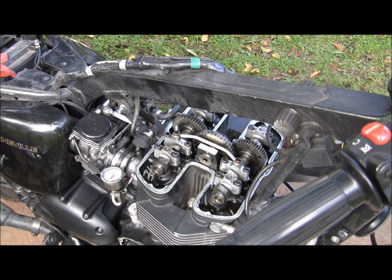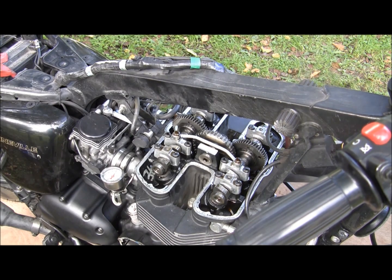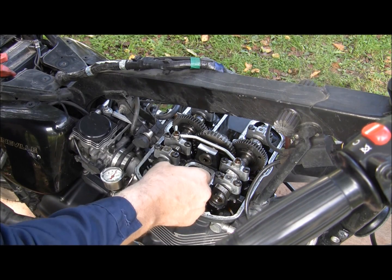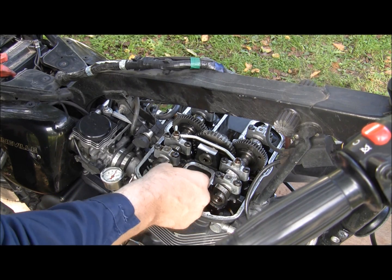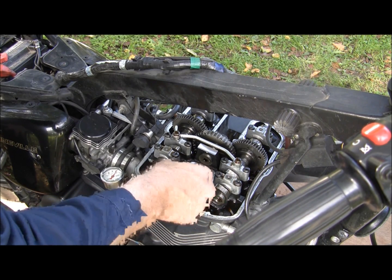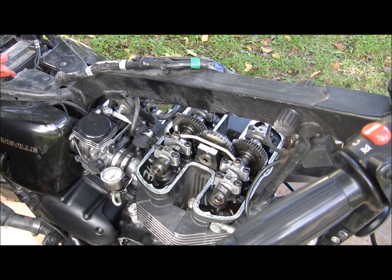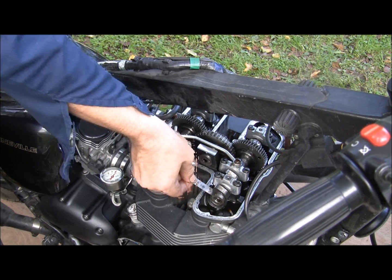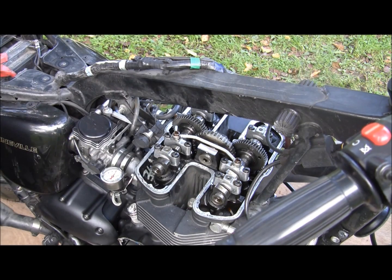Now, some time has passed, so I'm going to run the checks again real quick. The I1 last time was at 15. It loosened on me. So it's loosened in three months. Not much. So 30 there. 29, barely. That's tight. Okay, I'll call it a tight 29.